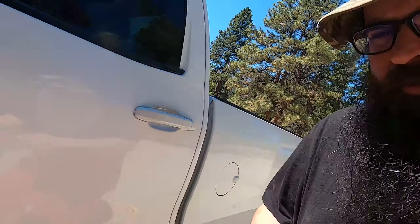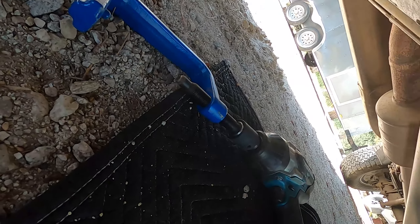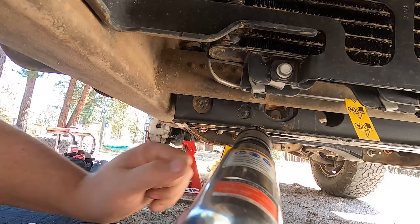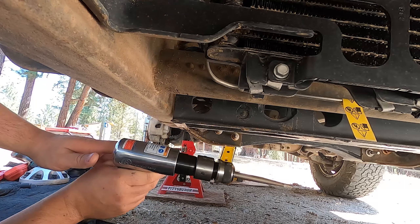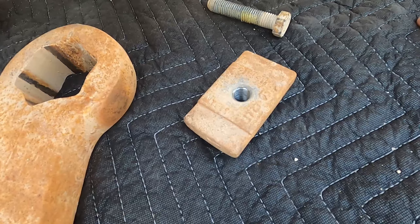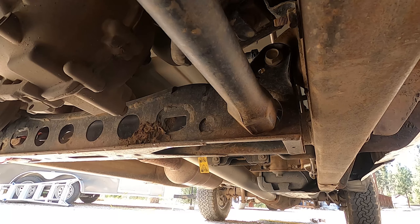It's the next day and I'm back at it. It's been a lot easier this time with the tools sorted. I got the first key unbolted — had to lower the adjustment screw a little first because it was maxed out. Now I'm going to try and air-hammer out the torsion bar. The stock key is out along with the retainer and adjustment screw. Next up is getting the new torsion key in — I've got it set to A1.